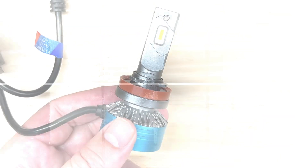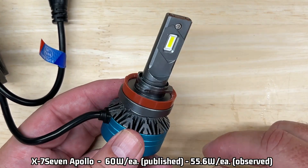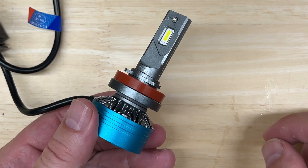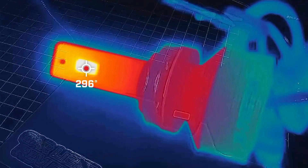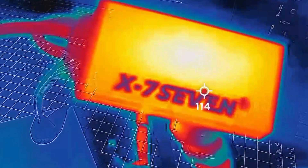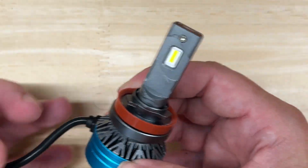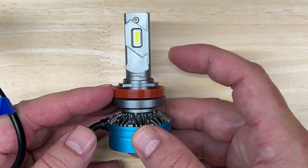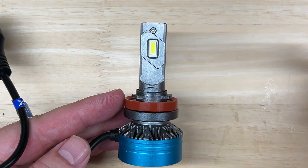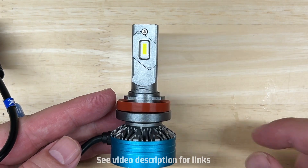The published rating is 60 watts per light; I observed 55.6 watts on my bench. For heat management after 27 minutes of runtime, my FLIR thermal camera recorded 296°F (147°C) for the main unit and 115°F (46°C) for the driver. For comparison to the X77 Aurora, the Apollo runs a little bit cooler, which may explain the higher retained output percentage over time. If you want to compare all specifications across all the lights I've tested, there's a link in the description to a free spreadsheet I update with every video.